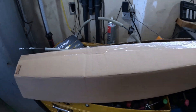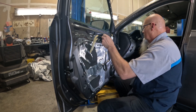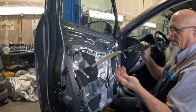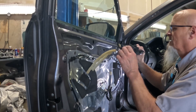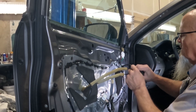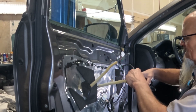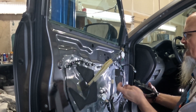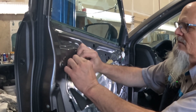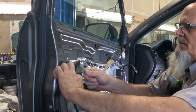Let's get this old latch out and make sure we've got the right part. I'm going to pull the interior handle off - okay, it just slides back. Pull the screw out and it slides back. And these are the cable ends for the lock and the door handle - get those out of there. Then I'm just going to carefully try and pull this plastic weather barrier off.